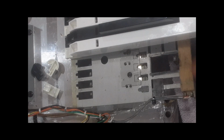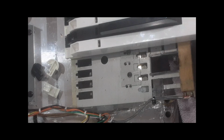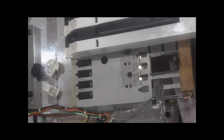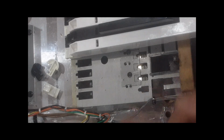Another thing to remember, when you're putting the key back in, in case I forget: if you hear a clicking, you can hear a little action, but not a click, click, click, a tiny click. If you hear a click when your key is in, either your spring is not doing something, or this switch is misaligned and this little plastic thing is hitting up against the switch. It's softer than that, but there's a little tiny click. The key should be very smooth and almost silent when you press it. Okay? That's going to make a sound because you're going to hear it up against the felts. When you push it down and it makes a tiny, tiny click sound, take the key off and reinstall it, because either the spring or the switch got misaligned.